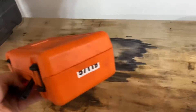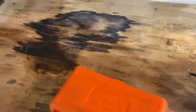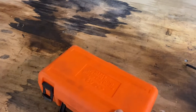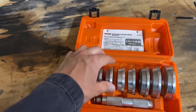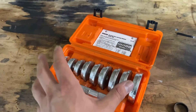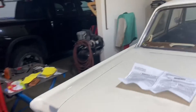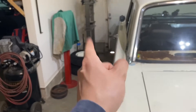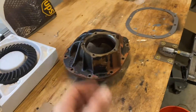I did go to the auto parts store and rent one of these guys — it's part number 57119 from AutoZone — and what that looks like is a bearing driver set. This will help us drive all of our races in, which will be good. And then for the actual bearing itself that goes in the carrier, we'll use a press over there, or just take it to a shop and have them press it on.